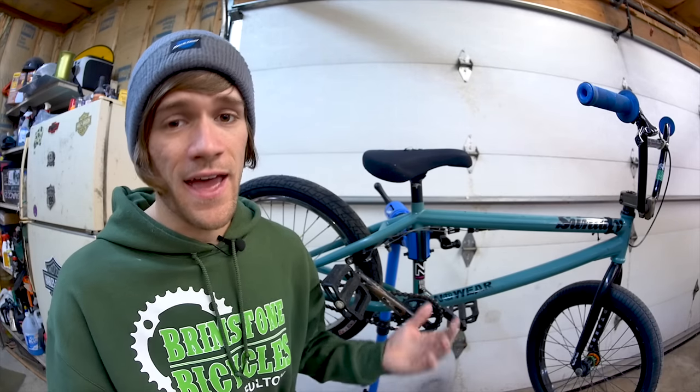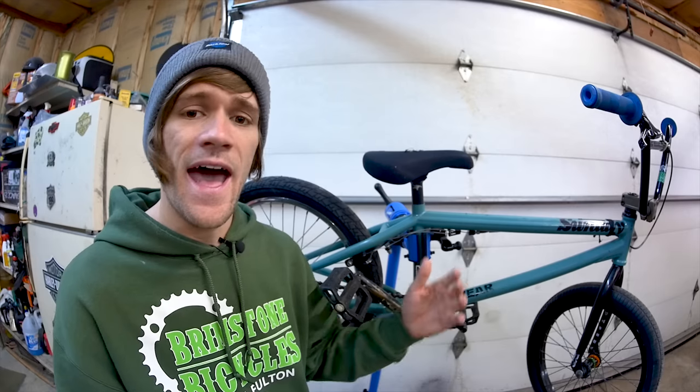When it comes to these things, it all comes down to cost. At a price point of a hundred dollars or less, you don't have to worry too much, because under a hundred dollars it's usually worth it unless the bike is completely destroyed — and that's pretty obvious. Honestly, I would never pay more than $75 to $100 for a bike with an unsealed headset, unsealed American bottom bracket, one-piece crank, and steel sprocket, because there are usually better deals out there for the same or just a little more money. Above that hundred dollar mark, if the bike has an integrated headset, mid bottom bracket, and aluminum sprocket, you can check a few more things.